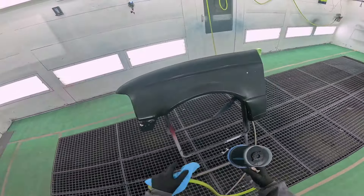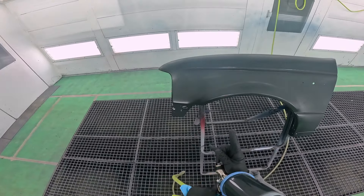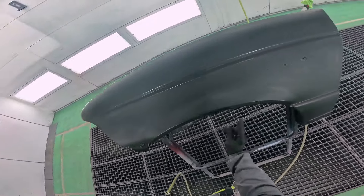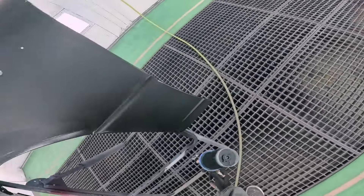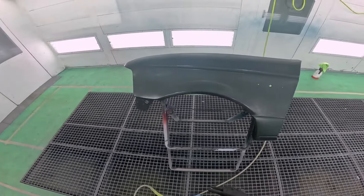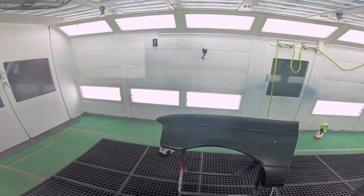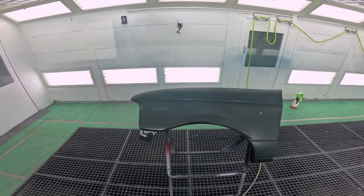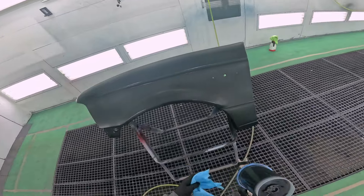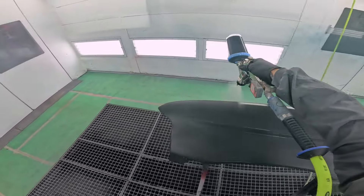The biggest thing when you're painting something, if you're new to this, is your gun angle. Keep in mind that the fan — I want the fan to be kind of parallel with the panel so I get a nice even layer. As far as top to bottom or bottom to top, it does not matter. The general thought is because the air comes in from up top and goes through the floor, it's better to start at the top and end at the bottom, but honestly I've never noticed a difference doing it either way.